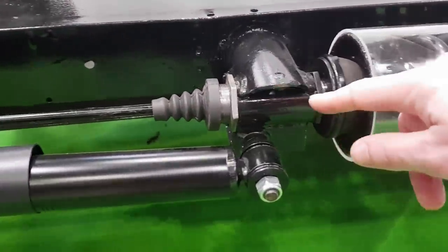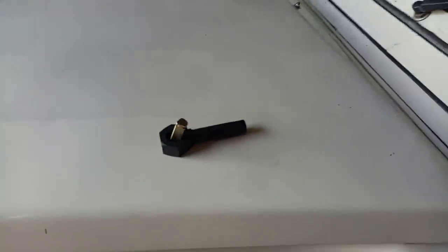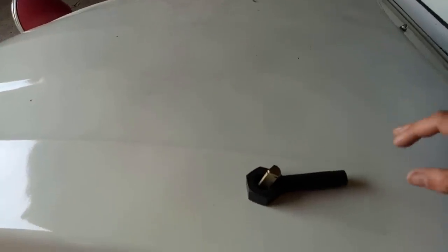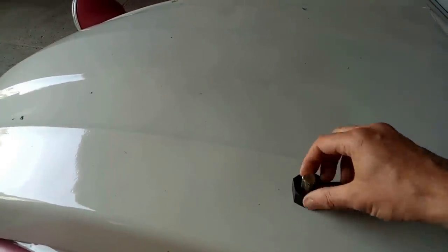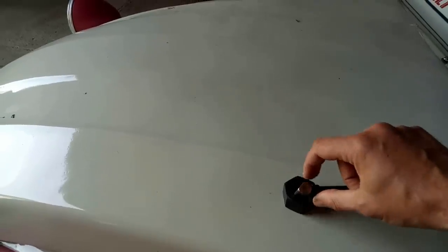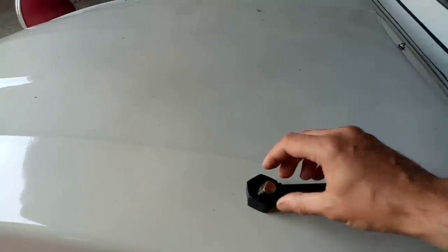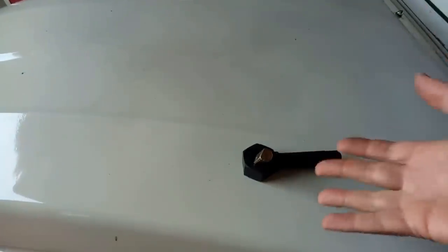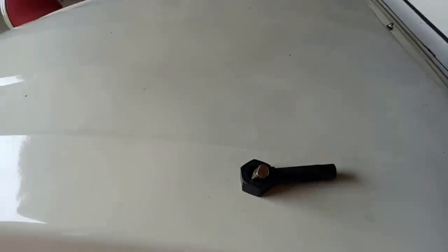The tie rods go all the way through here, through the chassis mounts to attach to the springs. I will jack Ellie up, take the weight off all the wheels, and I'll probably have to adjust the tie rod to release the tension. These are held with little R-clip type things on those edges. I can then pull them out, have a look, and assess - if I need replacements I have replacements; if not I'll just grease everything up and refit.